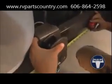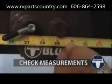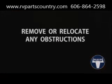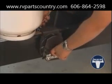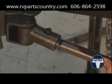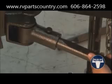Center and mount the rotating latches to the trailer frame over the marked areas. Remove or relocate any obstructions on the trailer tongue framework if necessary. Tighten the bolts on the rotating latch at this time. Insert the spring bar assembly into the hitch head pivots until the manual release pins snap closed and lock the bars into place.